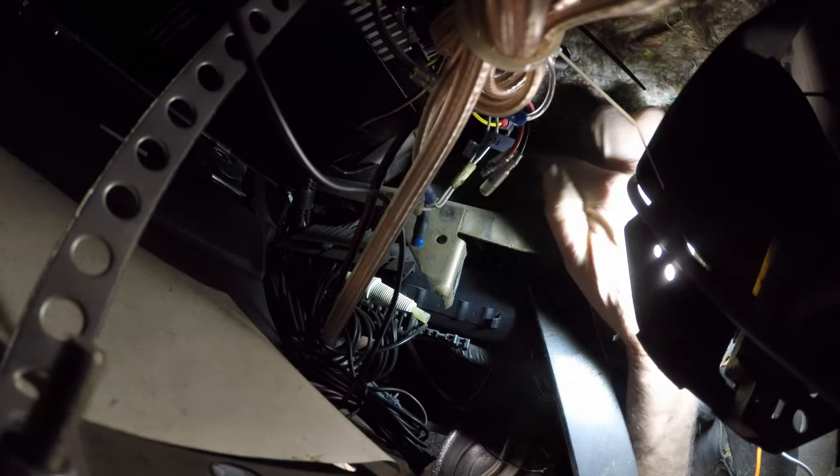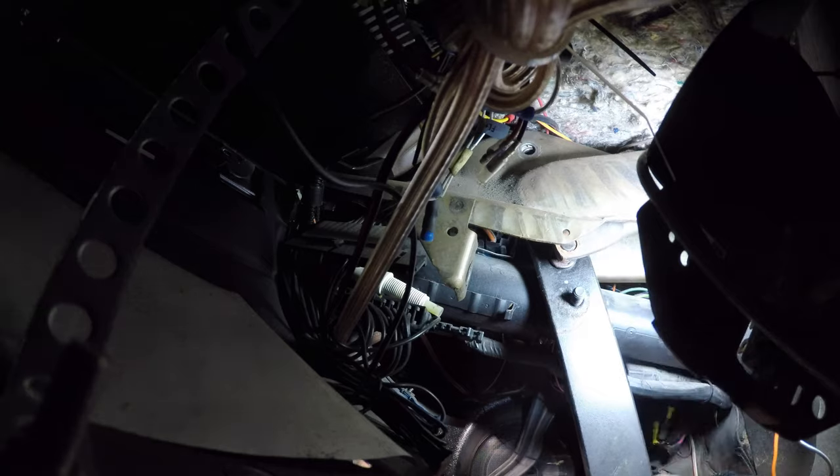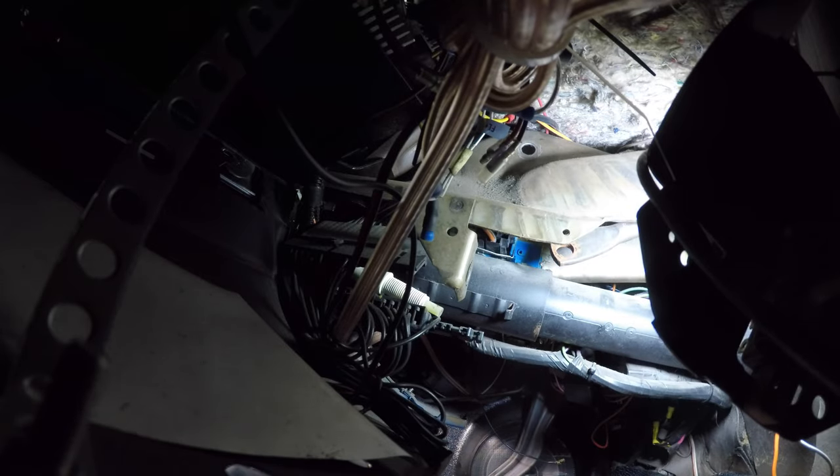Keep all that stuff from going anywhere. Now that's all off, I can take this bolt off on the top - that one's gonna be really tough to take off because it's been in there for a long time and it's a crush nut. I can slide my bolt out and now the pedal should come out - there we go. Let's take a look at what we got.